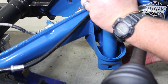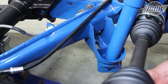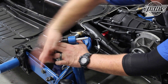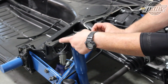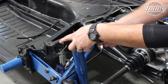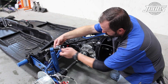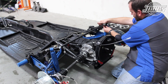We start the install by bolting the rear shocks in place to the trailing arms, making sure the spacers are installed at either side of the shocks. At the top mounts, longer upper shock bolts are installed through the shock towers and through the shocks. The cross bar end links are slid onto the bolts with the tabs pointing towards the center of the car, and the nuts are threaded on loosely. Then we can set the cross bar in place. It has left and right-handed heim joints and jam nuts at either end, which are bolted at the cross bar end links.